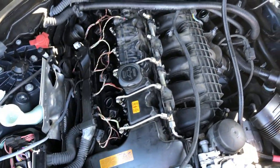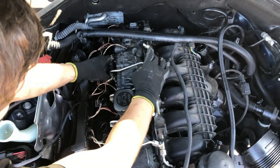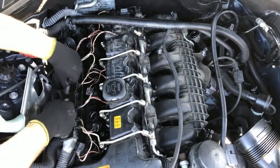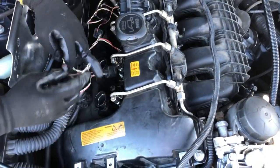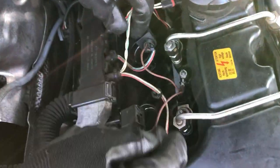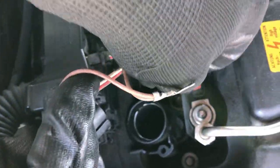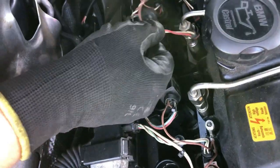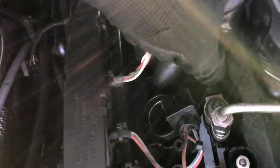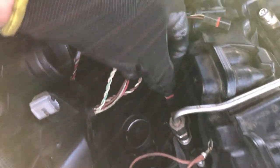It's 14 millimeter for the high pressure fuel lines. It goes nice and easy. You can't mess up the second set of wiring. Remember this goes in first. Then there are eight millimeter nuts here - and the coil connections. Everything is in a specific order so you can't mess it up. If it doesn't feel right going in there, it probably shouldn't. It's all very simple.